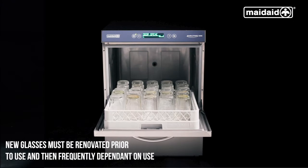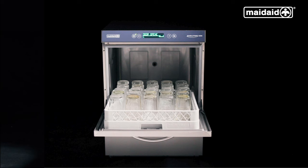To perform a wash cycle, open the door of the machine. An already loaded basket will need emptying and pre-rinsing prior to being loaded. Any liquid remaining in the glasses must be emptied into the sink and not the machine. Lemon slices and cocktail sticks must be discarded and any lipstick marks manually removed — this will help prevent false error codes and poor wash results.